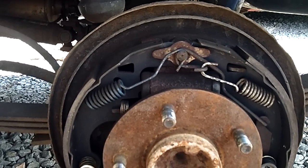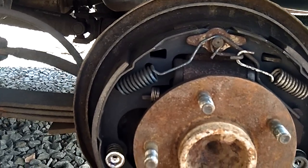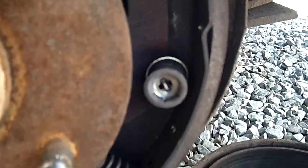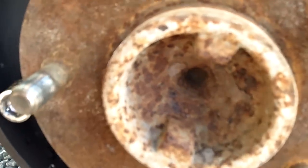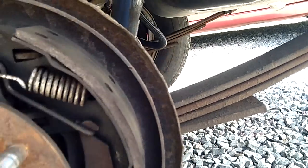I'm sharing this because not a single person out there has been able to solve this problem for me. Everybody said it's the brand of shoes, or your axle seal is leaking. No — there are new seals in here and they're not leaking. They're a little wet right there, but that's kind of normal. There's no residue built up anywhere in here as evidence it's getting onto the shoes. It's dry — just a little damp on the seal, not actually splashed anywhere. It's an old vehicle with 144,000 miles on it.